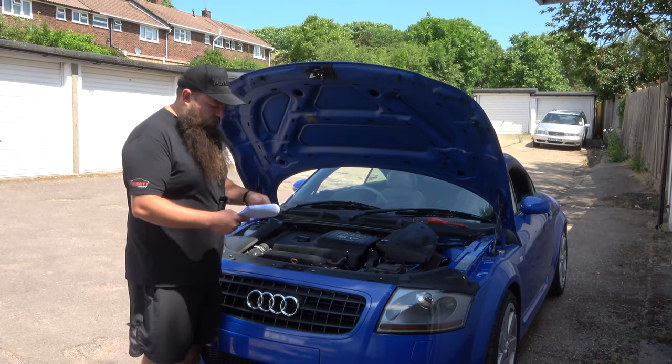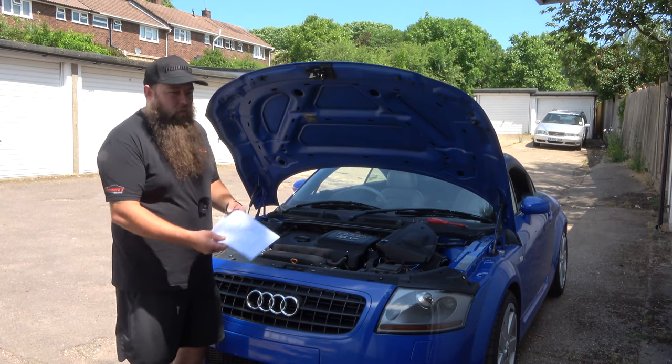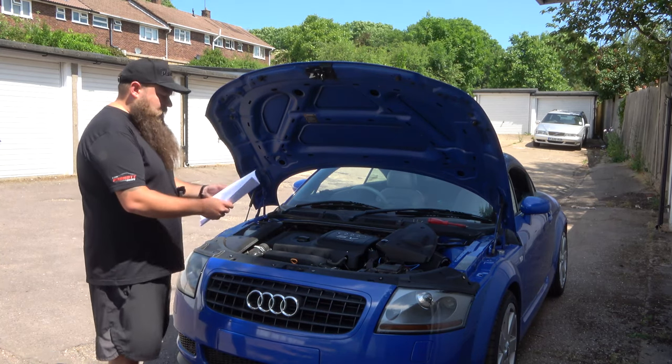With the AC — they are controlled by the fan control module. With AC off, i.e. econ on — when you press the econ button the aircon is not on, so the fans will not run. When you press the auto button the econ light should go out, you should hear the revs just blip as the compressor comes on because it takes a big current draw. Try all the other stuff first and then last change the fan control module, because quite often it's all the little things that contribute to the issue, not the brains itself.